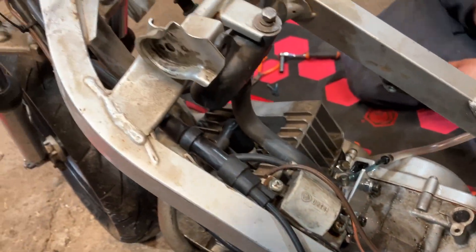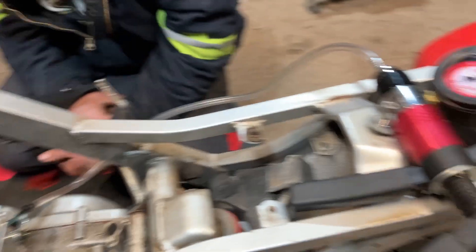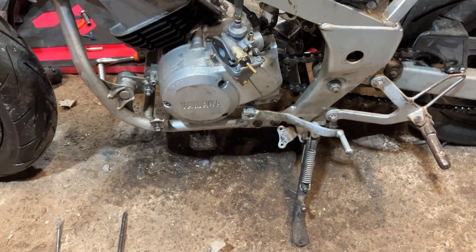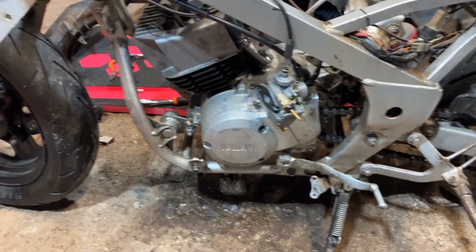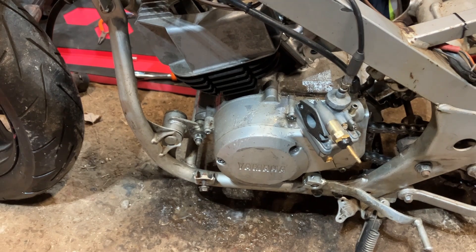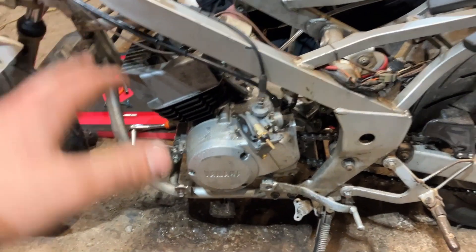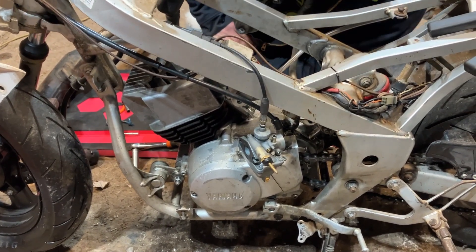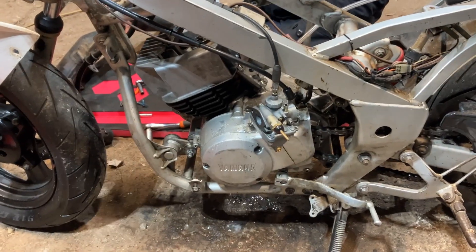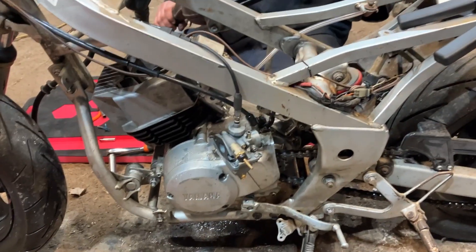This gasket material is just for testing — there's been some stuff where we couldn't get a gasket. We're still holding some pressure; you can see it is leaking down, but we do have that known leak there. You want to have it hold for at least 30 minutes ideally on a really good engine. If it'll hold the same pressure for 30 minutes, you got no leaks and you're good to go. If it's leaking sooner than that and it's not your test equipment, you've got a leak somewhere and you've got to find it. This whole setup with the pressure tester and all adapters costs probably 60 bucks, it's universal, and we can make it work on other things. Now we're going to fix her up and see if it'll run.